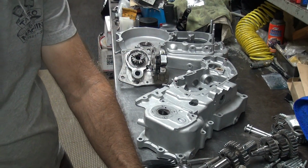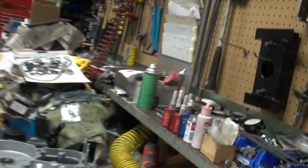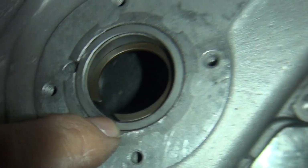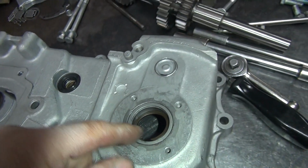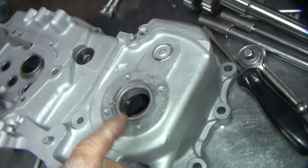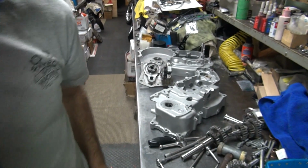Okay. So now the clip is in there at an angle. This one's below the groove, this one's in the groove. Oops, too far, way too close. So now we're going to hit on this side and we just pull it back up and it should pop right up in the groove. So you just flip it around and give it a light kick and it should go right in.